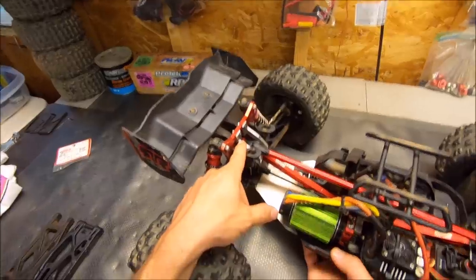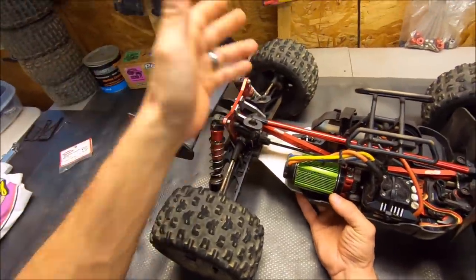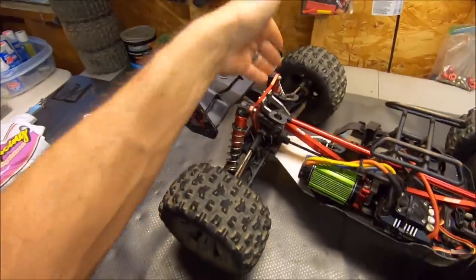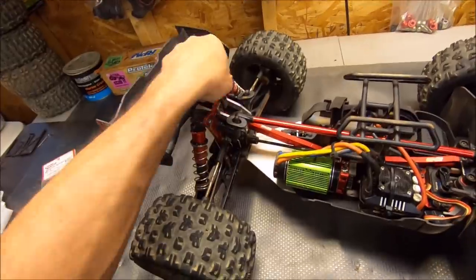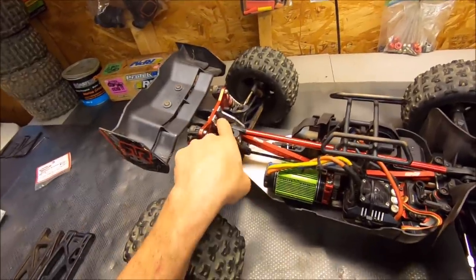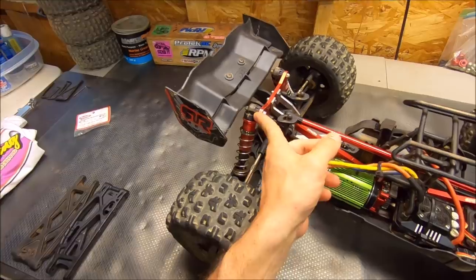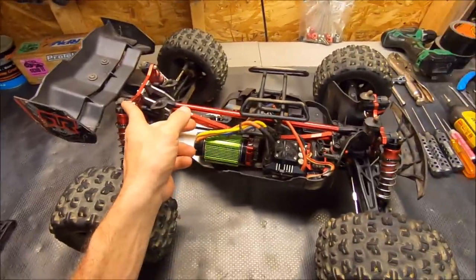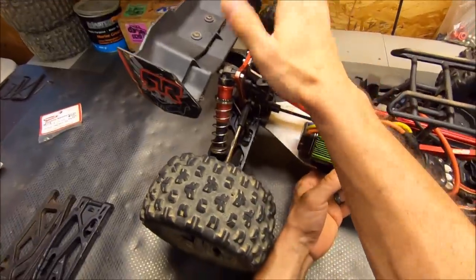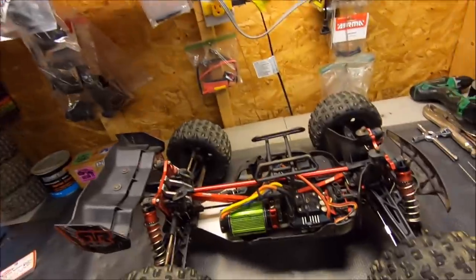I would definitely recommend the M2C rear tower brace — I'll put a link in the description. This really helps transfer energy down from the tower through the brace into the chassis in case of any hard hits in the rear end, accidental bad landings, busting your wing off, or catching the tower without a wing. It won't just bend your tower. It's 7075, very stout — much tougher than the stamped aluminum on RTRs, though it will bend if hit hard enough. I'm also running M2C shock standoffs in the back because I did end up breaking one of the stock ones. I'm still running stock in the front and haven't had any issues there, so I'm leaving those alone. Most of the time the back takes the most impact, especially on landings.